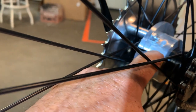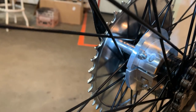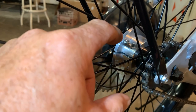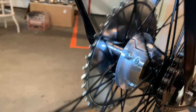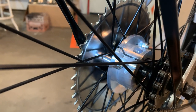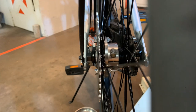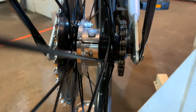A surface grinder, any kind of flat grinder, or a belt sander - just try to keep it straight as you can - to give you a little gap. That way it is clamping, getting the little fingers in there clamping on the bicycle hub. If you put it on there and it's just finger tight and there's no gap, then tightening it is not going to grip it to your drum assembly or your hub. If it looks like that, it will not turn no matter how hard you drop your clutch. Once again the big bonus of the CNC sprocket is how the sprocket turns really true and gives you less chain issues. You have to have the gap or the hub mount will not tighten.